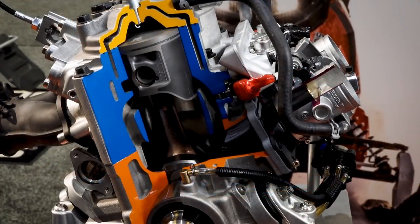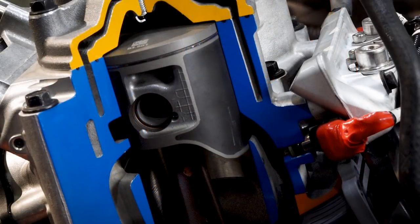Now on to the new 850 engine. This engine was designed not only to build a lot of power but also to be extremely durable. The piston dome is 3mm thicker and it also comes with a single steel piston ring.